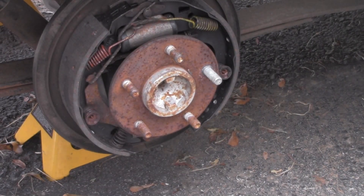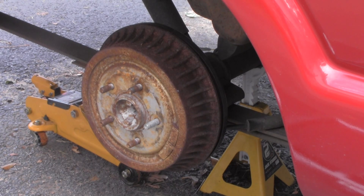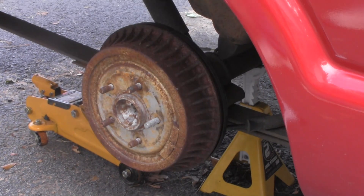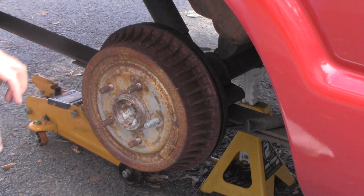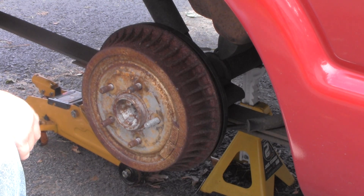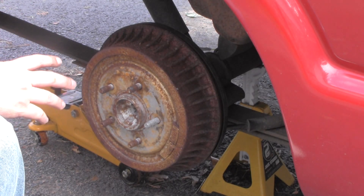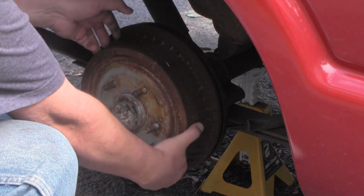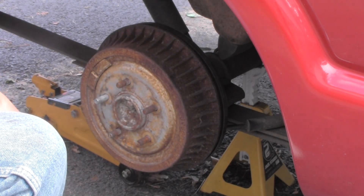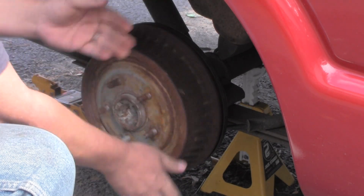Okay, that's in place. Let's see if we can get it in the truck. So testing your brakes after you do a brake job — in this case after we replace the cylinders — is a really good idea. I like to test them before I actually put the vehicle on the ground, so I at least have some comfort level that it's going to do what I think it's going to do. Okay, so here we go — we're turning. Are you hitting the brake? Okay, we're turning — all is good.